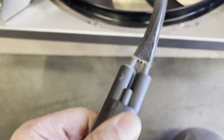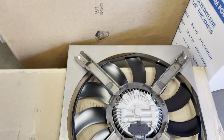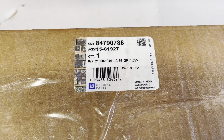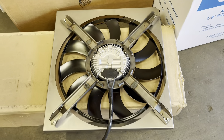We always cut this plug off and then hardwire it right to the battery and use a 100 amp fuse at the battery. Works pretty good. And that's the fan number right there: 84790788. That's the fan that we use in every conversion now.